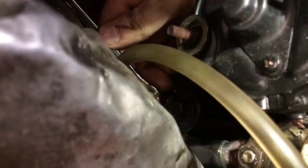A little bit more. So I'm gonna let the, oh, look at that. Yeah, I'm just gonna let this thing run for a minute. We got plenty of fluid, and that stuff is black. At this point, I'm kind of waiting for a color change, which I'm starting to see. Holy cow, look at that. Yes, this would cause a pedal to not work.